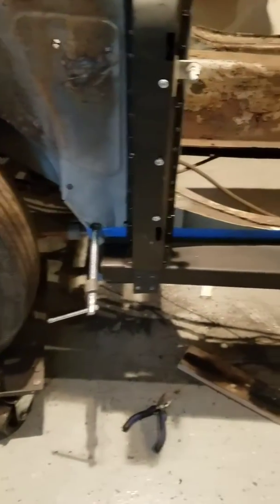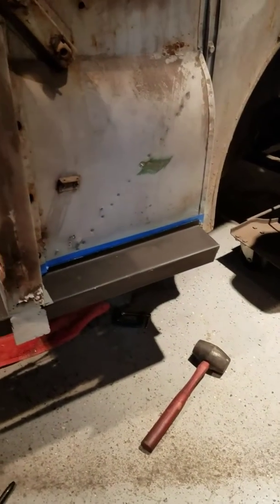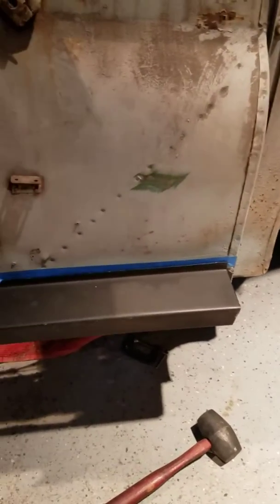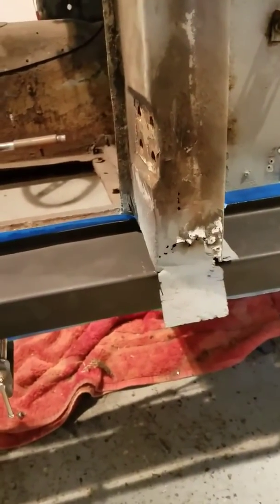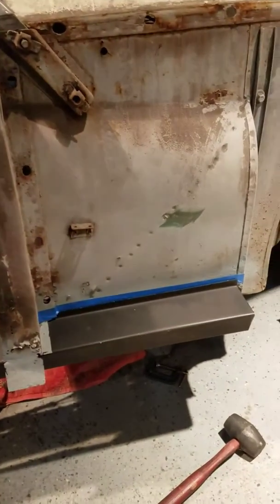I have some painter's tape here. When I take the inner sill down for the final fit and to drill its own holes, all the area behind that I'm going to coat — I've got automotive self-etching primer. Behind that is already a coat of weld-through primer that you can't really see too well. So welding this on won't be tough, and I want a really good protective layer behind the inner sill for when it's finally buttoned in and welded up.